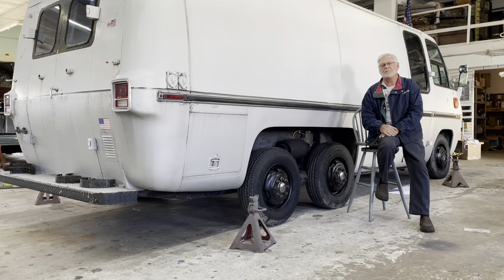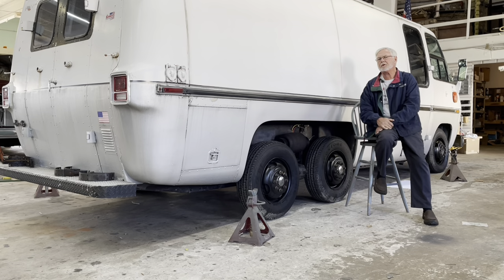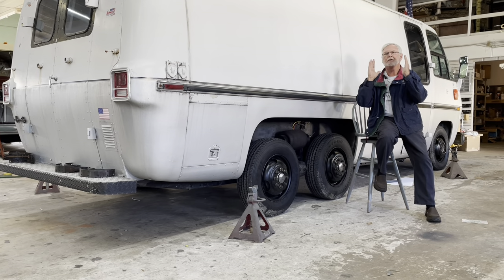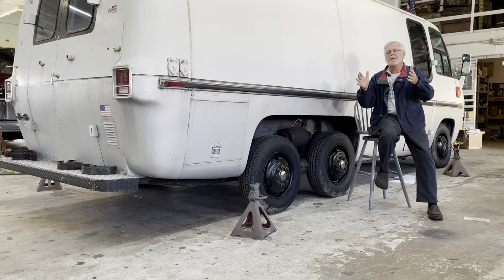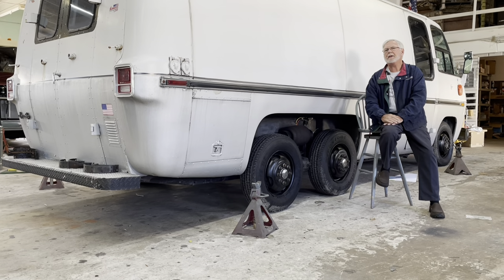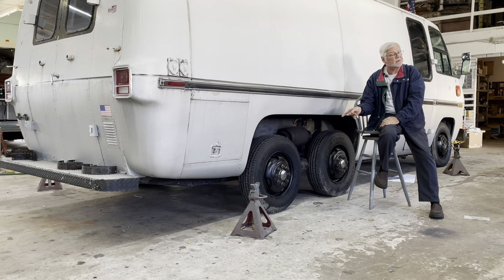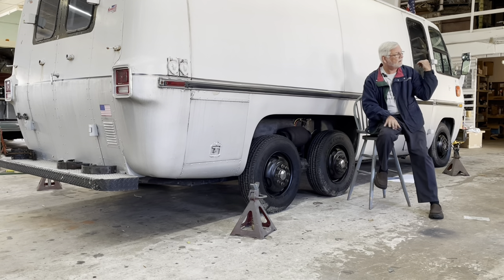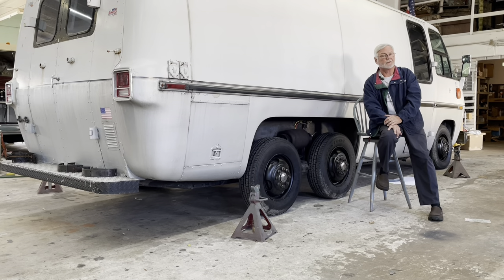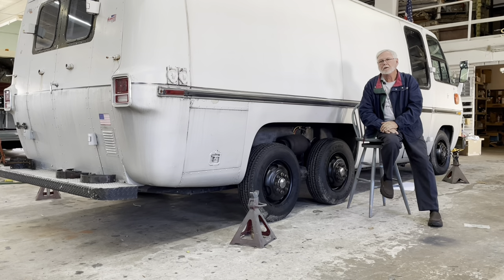Jim Bounds with Co-op Motorworks and Motorhome Rehab Ranch. Today we're going to talk about jacking the coach up. This coach is a little unique — the frame is a ladder frame, meaning it's two bars going front to back with cross members, kind of like a boat trailer. With the boat off, the trailer is just loose. So we have a loose frame that will twist as it goes down the road. If you jack the right front wheel up first, you could break the windshield, and chances are you wouldn't be able to open the door because the body will twist.